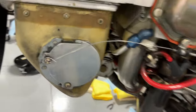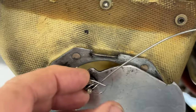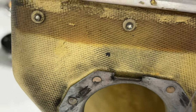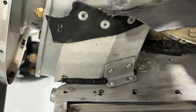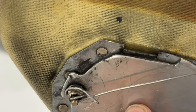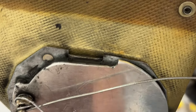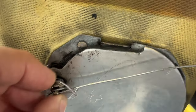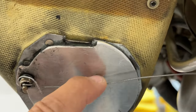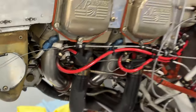This is a side-by-side RV-7. What you'll see here is your alternate air — this normally gets pulled back if you need alternate air, meaning maybe the air filter has got some blockage, ice, or something else. There should be a latch mechanism right here at the top — you can see right there, it's broken. So this thing is just sitting here vibrating and eventually it's going to break and come loose. Also, this wire is just way too thin in diameter to actually work properly.